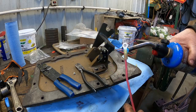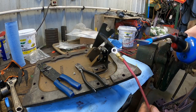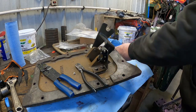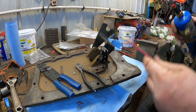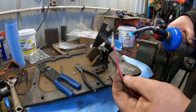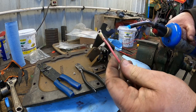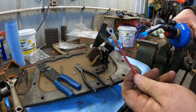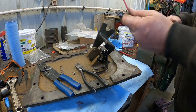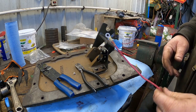You can now get these connectors pre-made with shrink wrap already on them. Seal it up and keep the whatnot out better. Cut the end off the original wires — it seemed to be the connection at the terminal that was bad, but I'm going to go ahead and replace the whole wire. I went with red because in the wiring harness the ones that connect to the neutral safety switch are pink, so it'll be pretty close.